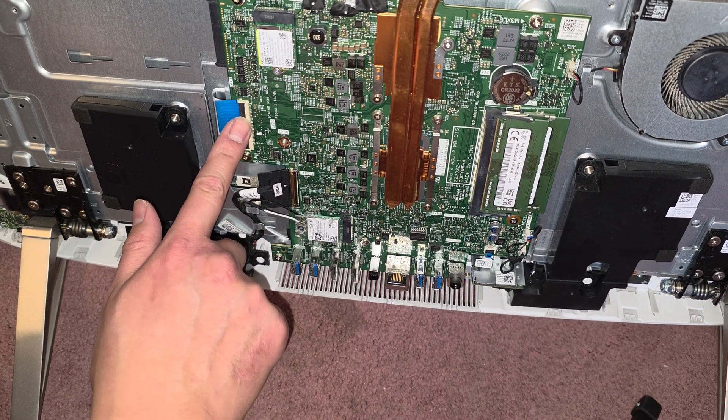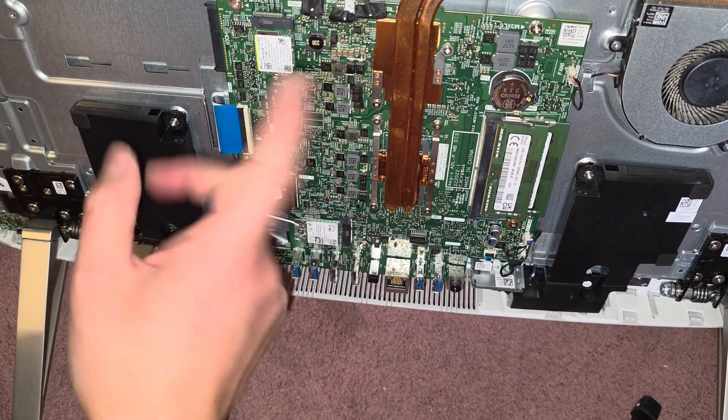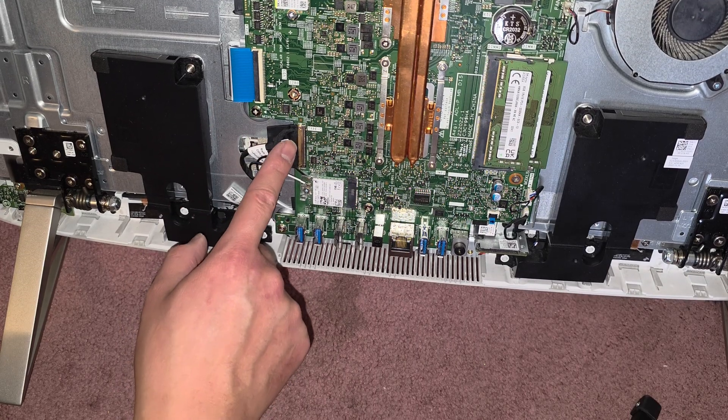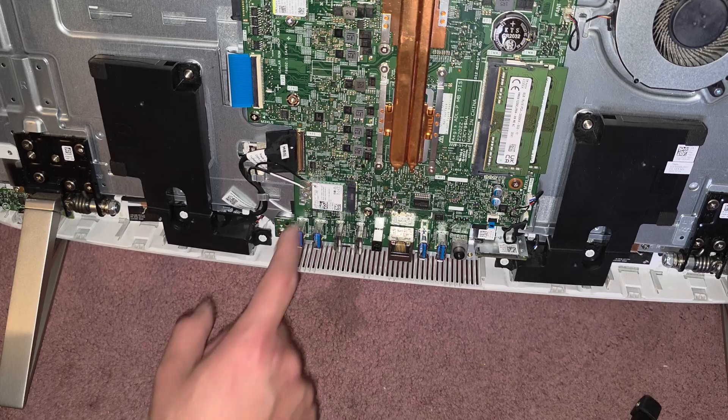If you're going to mess with this, you probably want to hold the power button for at least 15 seconds, and then you can flip this latch out. But make sure your computer is off before doing that. There are actually multiple cables here — this one says LVDS, so what is this other one? Type-C. So this connector is just for the USB-C ports.